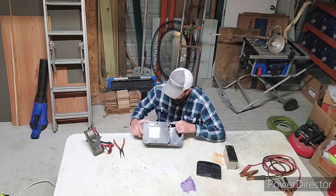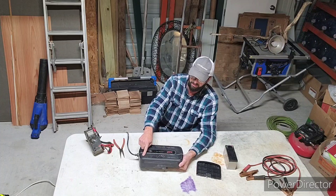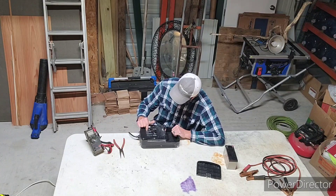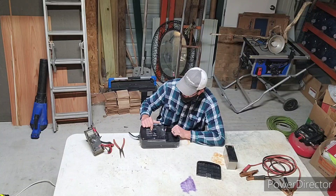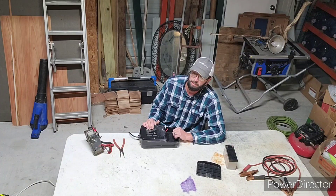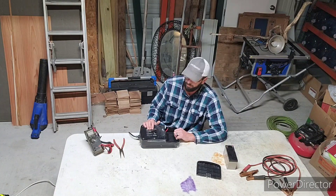You look right here on the back label — it'll tell you the output and what you should expect from the UPS side. One side will be surge protection and one side will be a battery backup set of plugs. On here it's going to tell you the UPS output: 120 volts, 60 hertz, 390 watts. So this has inside of it a 390-watt power inverter built in that'll take the power from this 12-volt battery and run your 120-volt appliances. This is not a pure sine wave inverter — this is a square wave or modified square wave inverter, so it's not going to be ideal for every application.